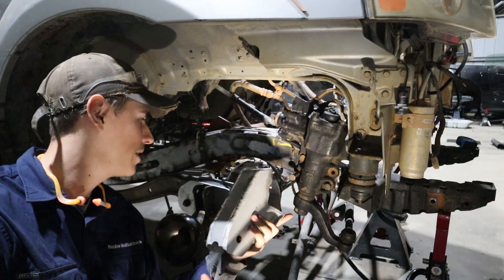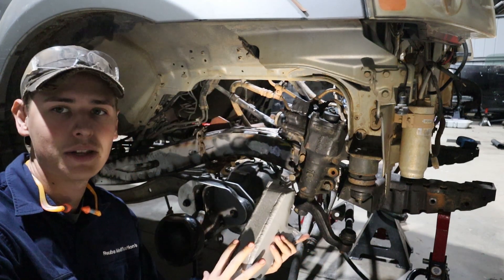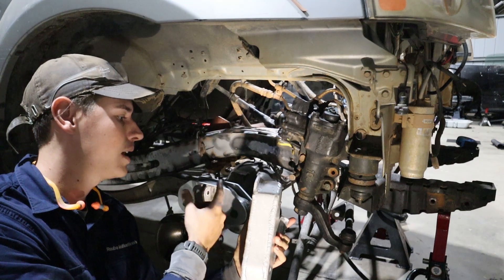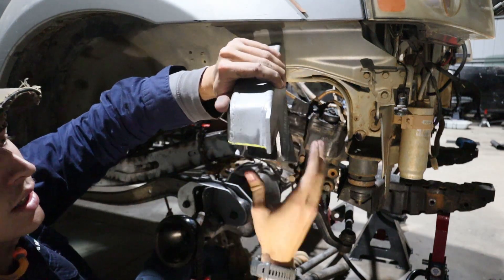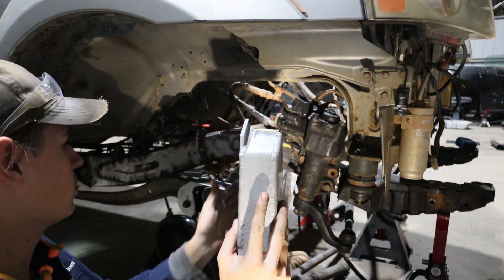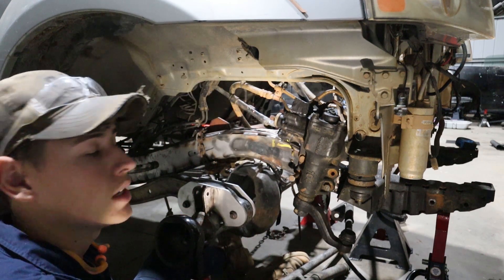We've been playing around with the panhard and the bracket — it's been in and out a couple of times and I've had to re-weld it. I wasn't happy with the bush binding up in the housing; it wanted to point backwards too far. I twisted it which stopped the bush binding, but then I had a massive gap on the left side of the bracket. So I've cut it on an angle and followed that line all the way down — now both sides when they contact it's pointed backwards to the diff side, which is pretty well perfect. The bush isn't binding anymore; the only place it's binding is on the other end, which we'll put a heim joint on and it should be great.